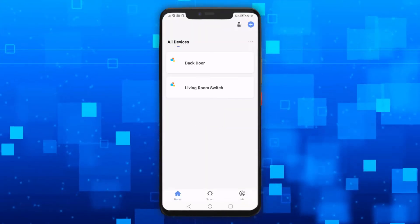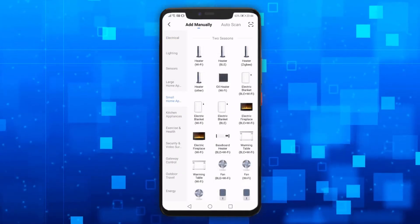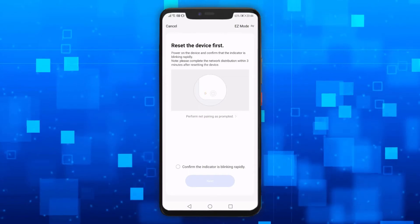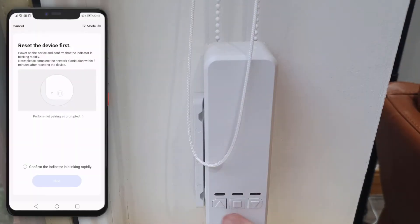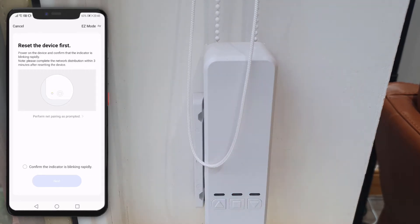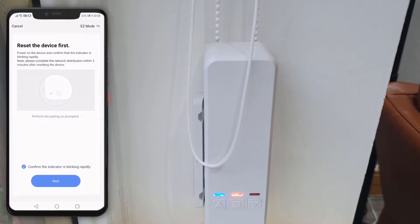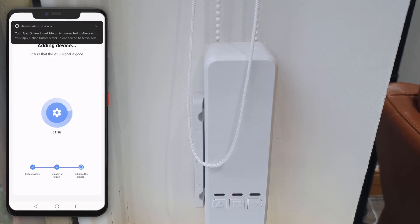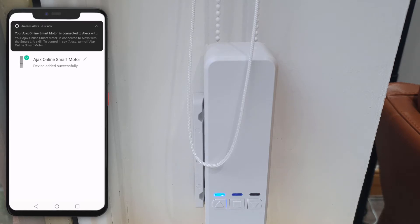Open the Smart Life app, select the small home appliances option from the menu on the left, and scroll down to curtains WiFi. Select the option and connect to WiFi. To get the motor into pairing mode, hold down the up and stop buttons at the same time — the trick is to press stop first, then the up button, so you don't manipulate the blinds. After about 6–8 seconds the lights will flash blue and red. In the app, confirm that the LED indicator is blinking rapidly and it'll take a few moments to connect. From hitting next to successful connection took around 25 seconds.